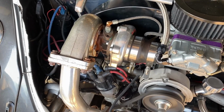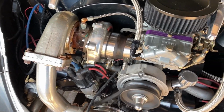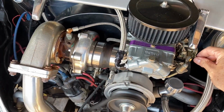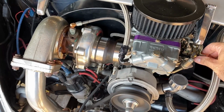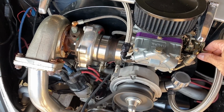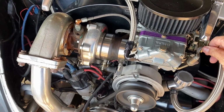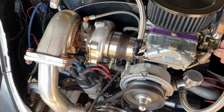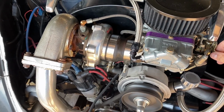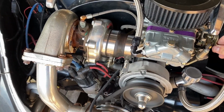So what is a traction bar? Well, a traction bar is a bar that keeps the axle from twisting backwards when you are accelerating hard, so all the force can be applied to the drive shafts to turn the wheels of your vehicle. So what I need is actually like a traction bar to stop the engine turning on the gearbox.